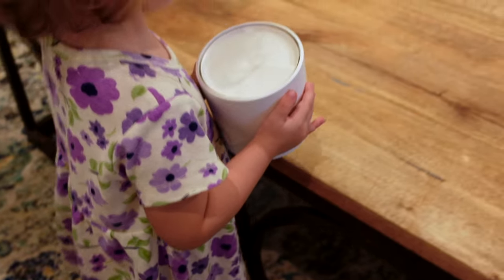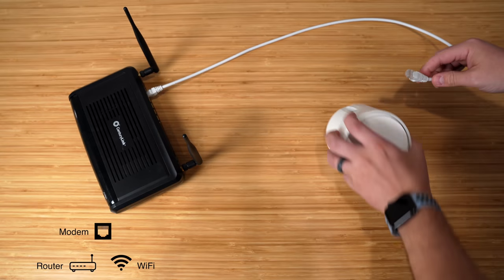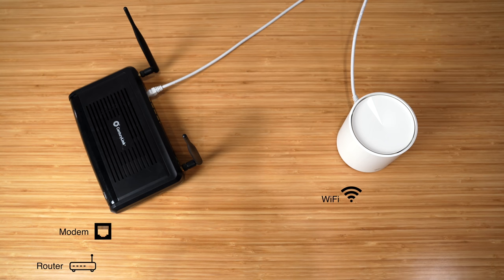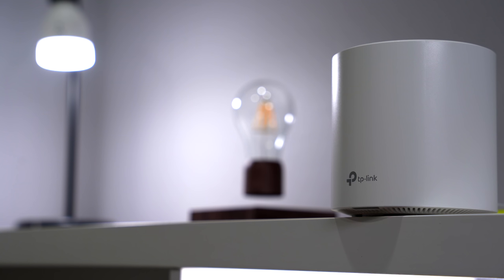This is why I'm surprised, Dad. Isn't our Wi-Fi fast enough already? Trust me, by the end of this video, you'll see why it's important. When you plug in your more powerful router into it, make sure to disable the Wi-Fi on your modem — that will help have less Wi-Fi interference. I would also put it into bridge mode so the routing is all done on your new router that you're plugging in. This will also help if you ever need a port forward later. Then all you have to do is use the same SSID or Wi-Fi name and password, and then all of your devices should switch over.